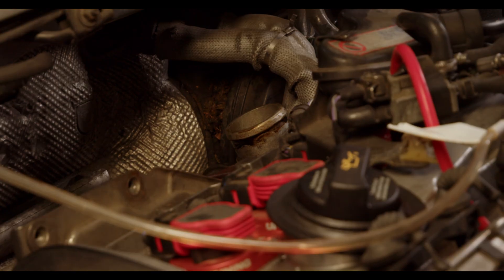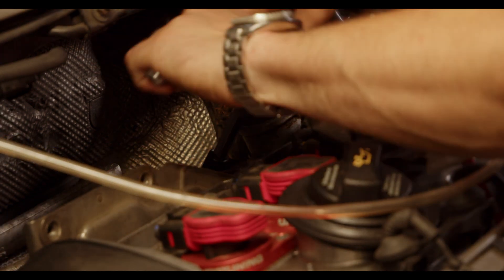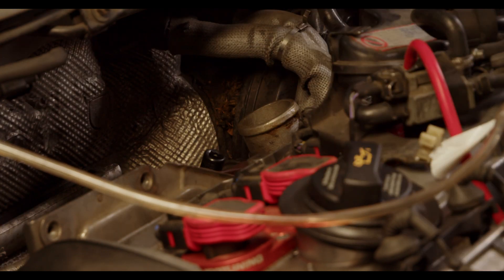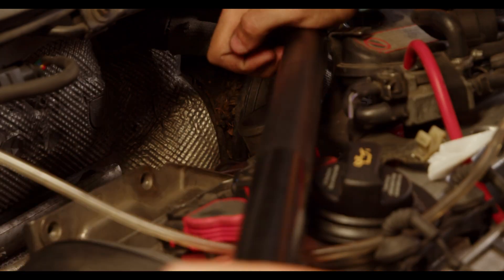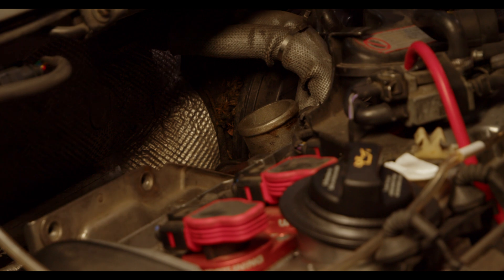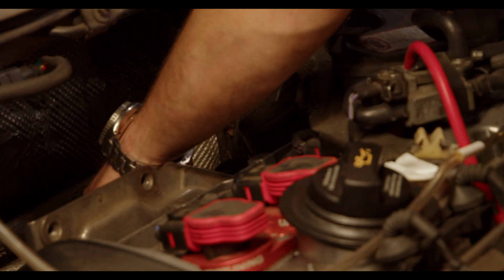Now we can start the really awful part of the job. We need to remove the turbo from the manifold, and to do that we need to remove the three bolts on top that connect the two — one is a security bolt and the other two are reverse torx. These bolts have a bit of a reputation: generally if they've never been removed before and your car is high mileage, they are either seized beyond removal or they're going to round off. The latter happened to me. Even though these bolts had been soaking in penetrating oil for a week and I used the correct socket, the first time I applied any torque, the entire head rounded off. Weirdly enough, the spline bolt came out though, so we're going to have to figure something out.